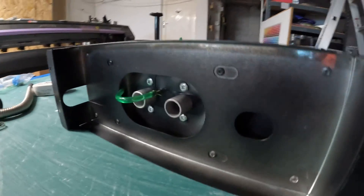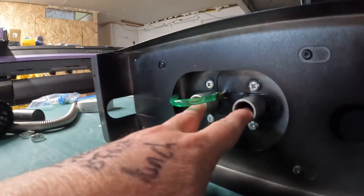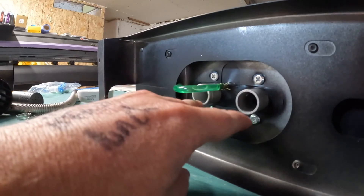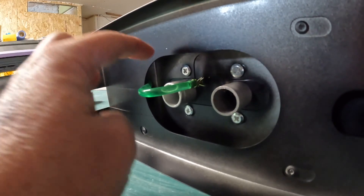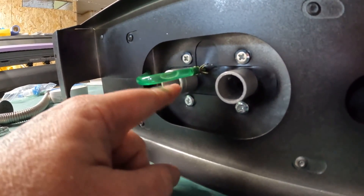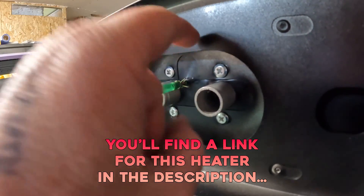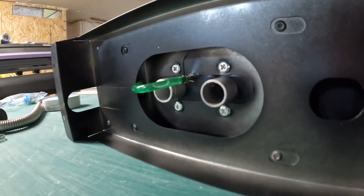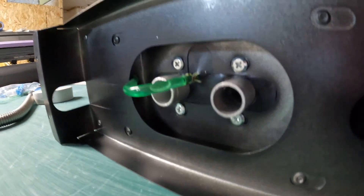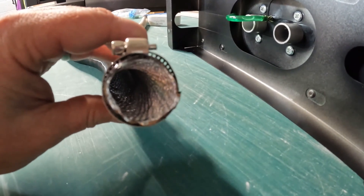Now that you've accessed the bottom of the device you can see the undercarriage. You've got a port and an outlet — they're both the same diameter, they look exactly the same. What's important to note is that the air filter and the airline connect onto the one on the left-hand side, depending which way you've got it flipped over. It is the one nearest to the fuel pipe. You don't want the fuel pipe closer to the exhaust — this is the exhaust, and the air intake is right next to this fuel pipe. You might need a long screwdriver just to get to the jubilee clip.